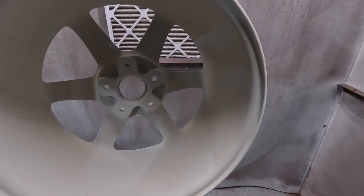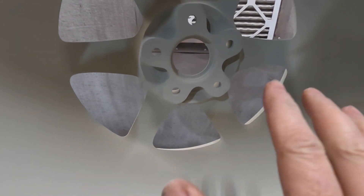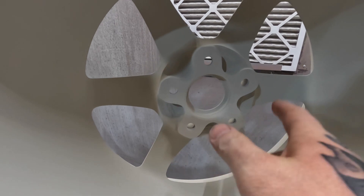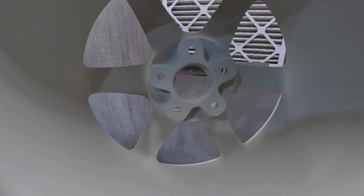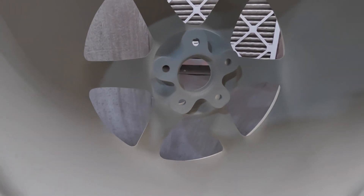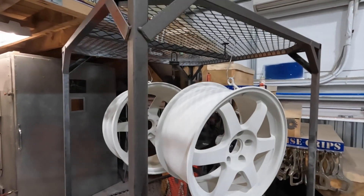On the back mounting surface, at least on the first coat, we will leave it in primer and not bring that down to bare aluminum. Up here in the northeast we've got a real problem with corrosion, but we've never had a fitment issue and the customer can always sand that down to bare aluminum. We won't put the other two coats on it. This is a three-step process: primer, base, then clear — because this color requires a clear. The entire wheel gets primer in its entirety.